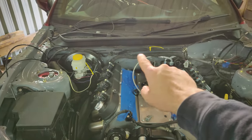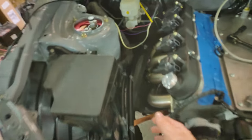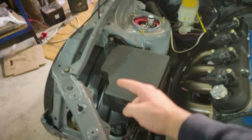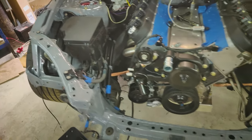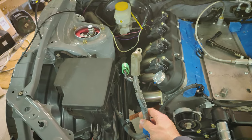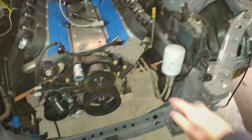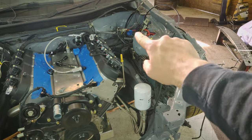What I'm going to do is — the wire would have come down here, round that into the fuse box. I'll be able to find it if I separate the fuse box, pull it off the bottom of the relay it comes out from, and then just route it easily. I also need to remove the old alternator charge cable and signal cable — obviously no point having those because the alternator is going to be down there, not there. So I'll run a new one; the harness comes with a new one, and then I'll run a big fat cable up to the battery.